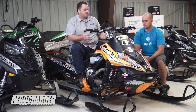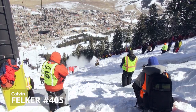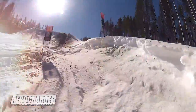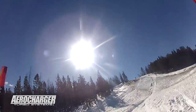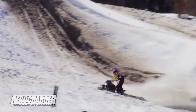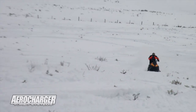How does this transfer over to the powder market? Race sleds have a lot of different suspension because of the terrain they're going over — it's quite a bit different than the soft, fluffy backcountry stuff. You've got to have a wide front end for racing. You're trying to hit those gates; it's all about time. The track's another huge difference. We run a soft compound for the backcountry so it doesn't trench and gives you some lift. In racing, the snow's harder and frozen — you've got rocks, so we have a really hard compound track with screws and titanium plates on top.